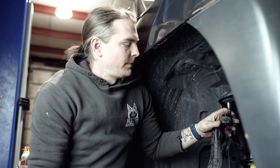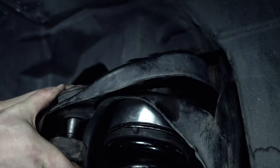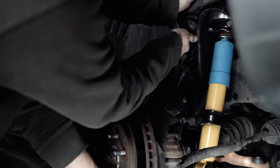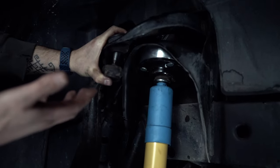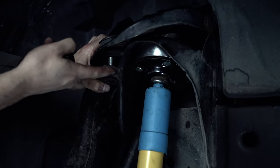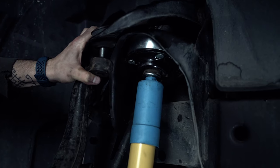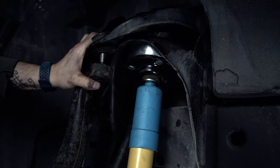The reason you have to force everything is that you're binding your lower ball joint, which is a big no-no. So besides not running spacers as we generally recommend, especially don't run a three inch lift spacer. We've removed the coil spring from the coilover assembly here to make it easier to show the clearance issue as we bring it up. You can see I physically can't connect the spindle because the ball joint is right at its terminating point and we're already on the coil bucket. When installing a spacer lift, you actually have to jack up on the bottom of the spindle just to be able to connect it to the upper control arm.